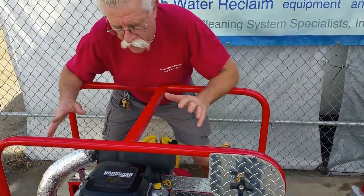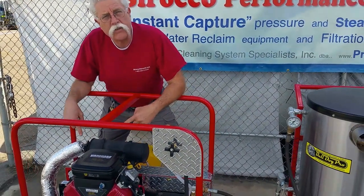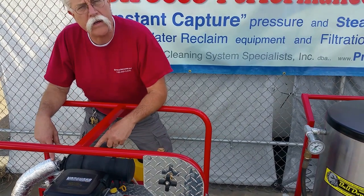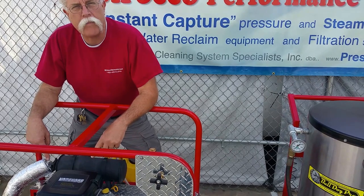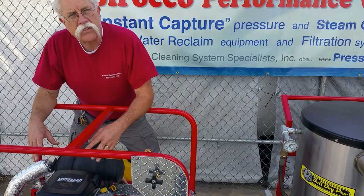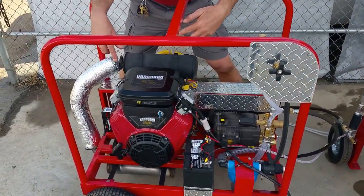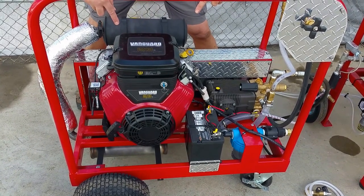Hour meters are your friend if you want to be meticulous about maintenance and make things last a long time. These engines have finally been approved by the manufacturer for synthetic blend or even full synthetic oils — they admit synthetic oil makes them last longer. We recommend synthetic 10W-40, and even a high-mileage synthetic blend is better than cheap oil. It only holds about a quart and a half of oil, so give it really good quality oil. It has a better chance of living a long time, especially running in the desert or high temperatures.